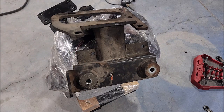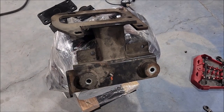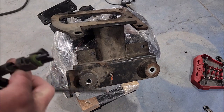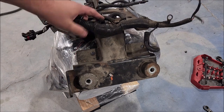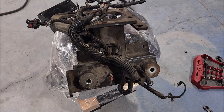As far as that alternator not working, the alternator does need an ignition signal, hot with key on kind of thing, on one of these pins, and it probably wasn't getting that, considering I thought this pin would have been for my power wires coming off the generator. Oh, how silly am I. So that probably needed 12 volts, and then the alternator would have known it was on and started working. So the alternator may work fine. I don't know. Further diagnostic is necessary to determine that.